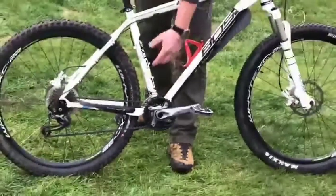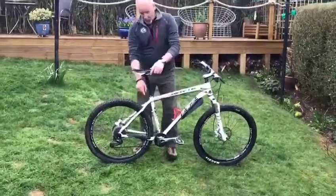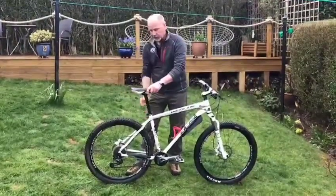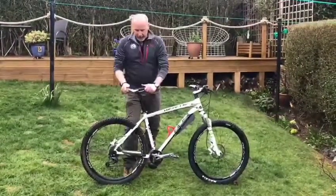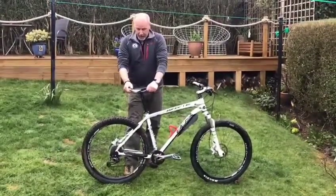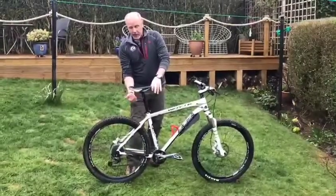We're then going to come up to the third bit of the M, checking the frame as we go to make sure it's in good order. All the way up to the seatpost — if you've got a quick release, the same applies as the front one, make sure it's done up at the right tension. Then check the seat — wiggle it side to side, make sure it's nice and fixed, then wiggle it up and down and make sure there's no movement. If it twists, tighten the quick release. If it wiggles up and down, there are a couple of screws and bolts in there you can tighten up.